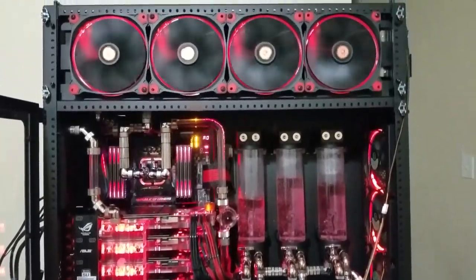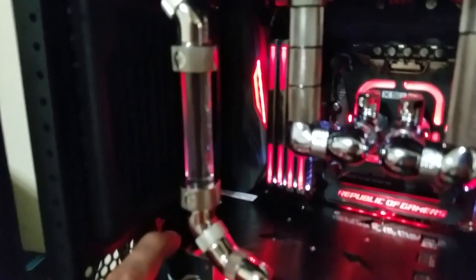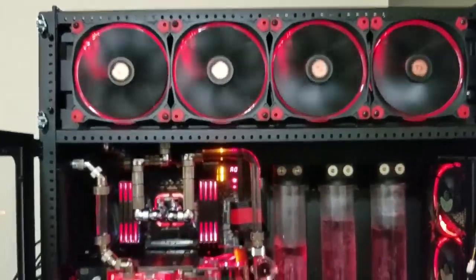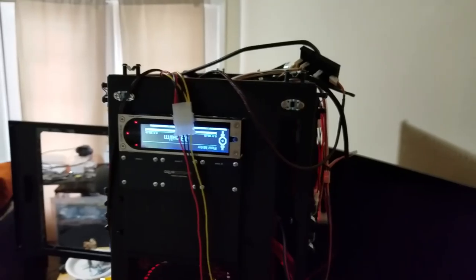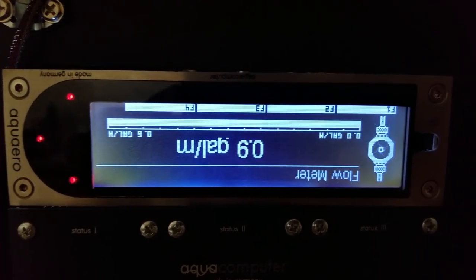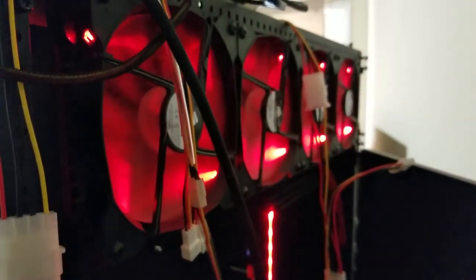The fans look pretty good. I'm gonna have to add another 120 millimeter fan back here — I originally didn't want to because I didn't want to lose sight of that Rampage heatsink, but I think it'll be fine. The front ring 12s look good. I've installed the Aquaero XT upside down, as you can see, but it's reading 0.9 GPM on the Aqua Computer flow sensor, so that's good. Besides the crazy wiring, everything else is ready to go.